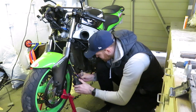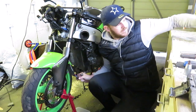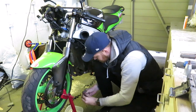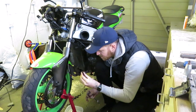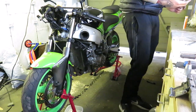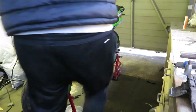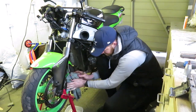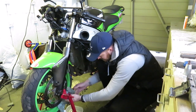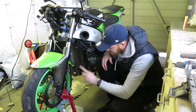I recommend you wear gloves for this, but I'll wash my hands straight after anyway. There's one colour-coded fitting — I'll take that off. I've got new union copper washers. As I'm letting that drain off, I will also put an old rag across the bottom of the wheel so I don't get any fluid on it — and if it does it'll soak onto that first. It should be fine if you catch it soon enough; you won't strip the paint. I do need to touch this paint off anyway because it's a bit checked.